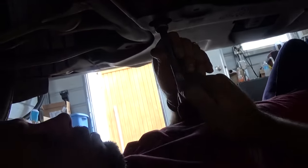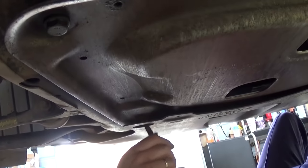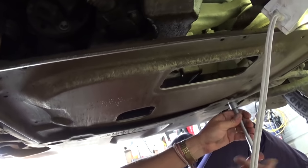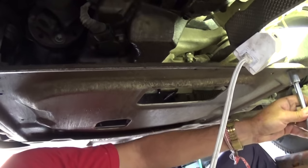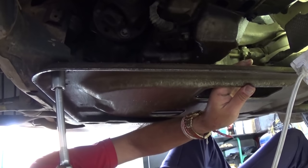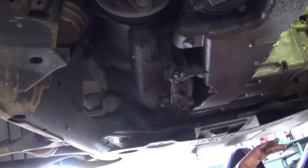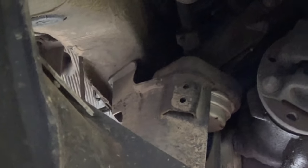Now with a 16 millimeter wrench or socket and a ratchet, we're going to remove this crossmember piece — that metal plate. It has four bolts holding it: two in the front and two in the back, so we can get more access and reach the engine mounts. We'll be doing almost everything from underneath the vehicle, so you need to drive it on ramps and put jack stands underneath for safety. After removing the metal plate you can see how much more room we have.